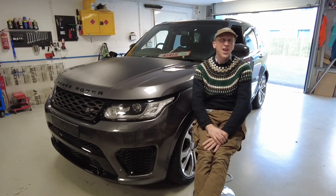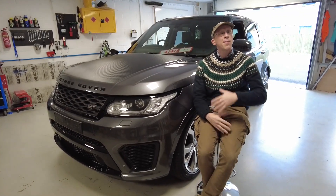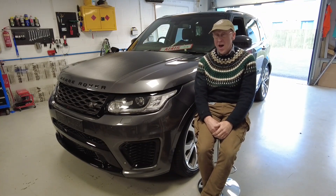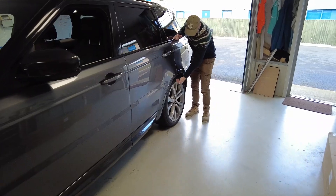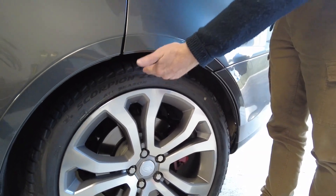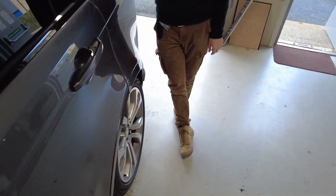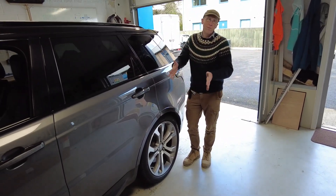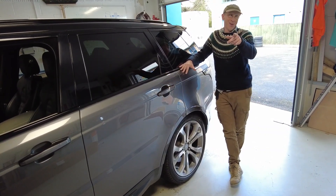That is enough for today on air suspension. The IID tool is a good way, and those rods are another good way — but think about what you're doing and why you want to do it. We're going to lower it minus 20 in low rider mode. We've also got to look at wheel spacers, because when you lower the car your wheels and tyres go up inside the arch, so adding 20mm wheel spacers means we'll need to be careful and may need to adjust suspension heights in combination. Being a boy racer is hard work! Anyway, good luck, have fun.